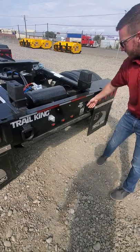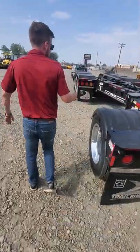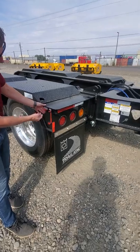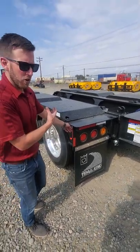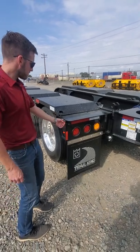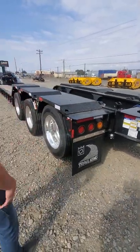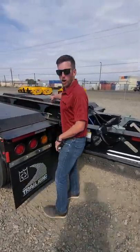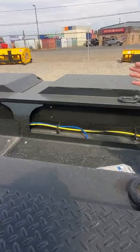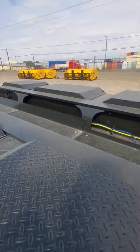At the back of the trailer and the flip axle, you've got a four-pull auxiliary circuit tied to your clearance lights. That comes off the center pin of your truck, as does your strobe. You need power to the center pin of your seven-way plug on your truck to power your four-inch amber strobes. You also have a remote flasher option — even if the gooseneck is disconnected for loading equipment, all of your lights are going to flash on the back, signaling that you're in the process of working. All of the air lines on the trailer are color-coded: yellow is for your lift axle bags, green for pressure protection, blue for service, and red for emergency. If you have any type of leak or anything to troubleshoot, those lines in your manual will help signal where you need to look.